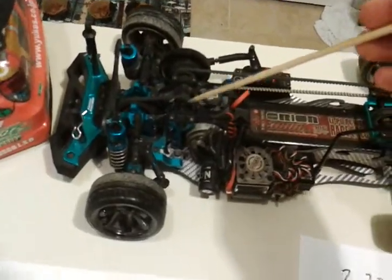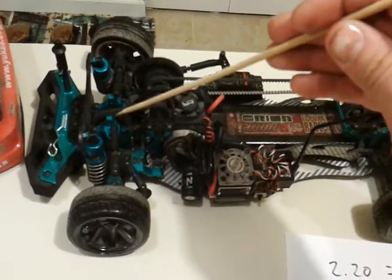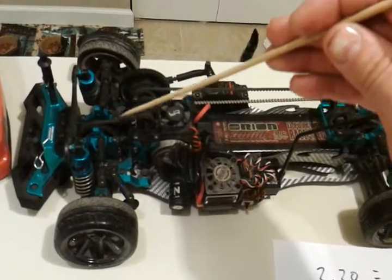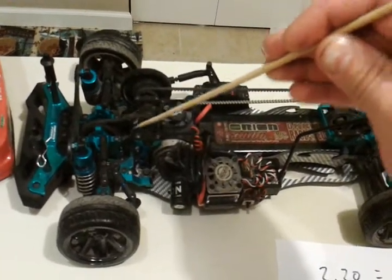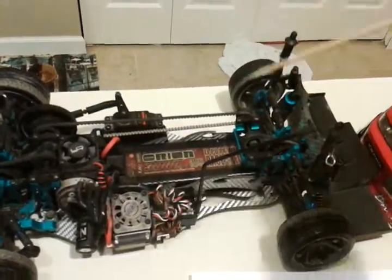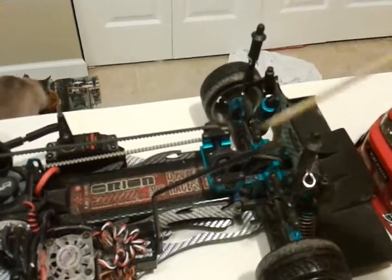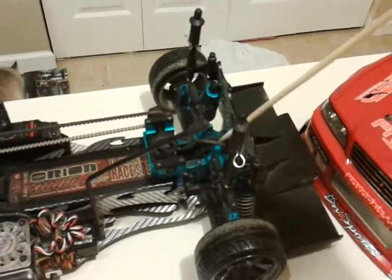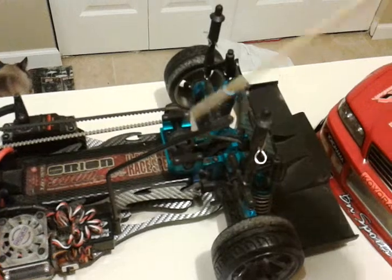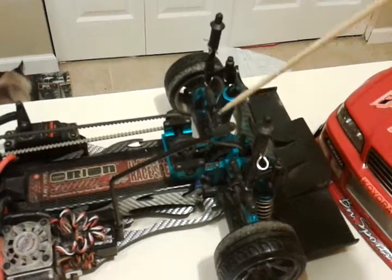The front's a 39, and this front middle is a 15. I didn't bother going up on this one because the adjustable cams inside of the bulkhead allow me to make the belt tension just right. So this stock 18 went down to 15 right here. Now the middle rears — normally stock is 18. This 18 went up by 4, and this 18 went down by 4, so this is a 22 and a 14. Now for the rear — the middle rear and the rear — this is a 21 and this is a 36. Stock is supposed to be 18 and 39, so I went up by 3 on this one and down by 3, keeping my belt tension perfect.